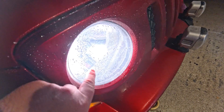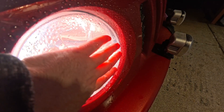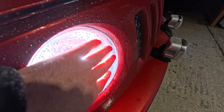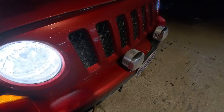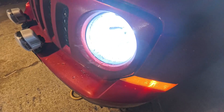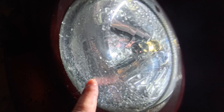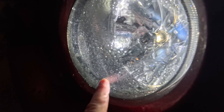The water on the front of the incandescent side is liquid, and if I move my hand across it, it feels physically warm — I'm actually getting nice comfortable heat off of this, probably about body temperature. And this one here is the LED side. It looks like there's steam or something coming off of somewhere, but this right here — this is ice. Even here on the lens, that's ice. So it is presumably melting it a little bit, but certainly not anywhere near as much as the other side.